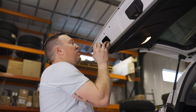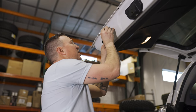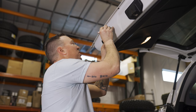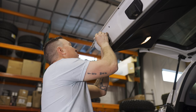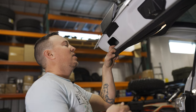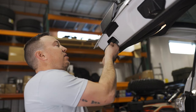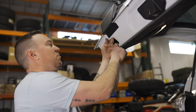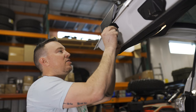Just so we don't have any rust issues back here, we're going to take a paint pen and color in the inside of our hole where we drilled, so there's no bare metal in the equation. Now with this plug removed, we're going to slide in our rail here. Once we get our holes lined up, get these bolts started and then tighten down.